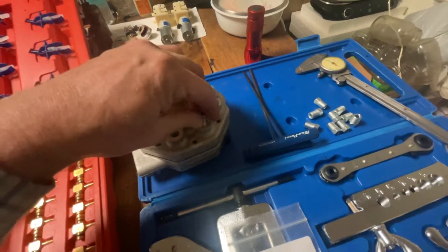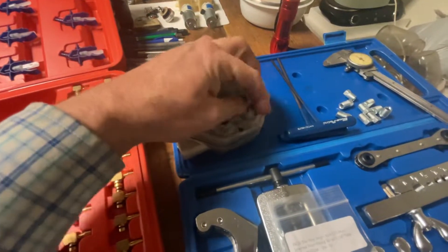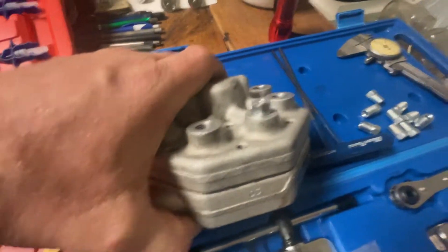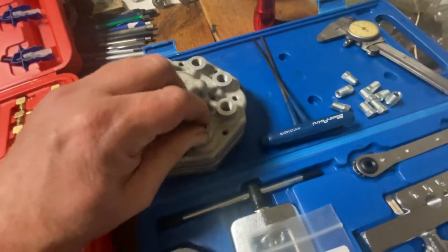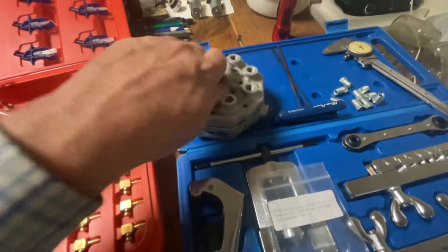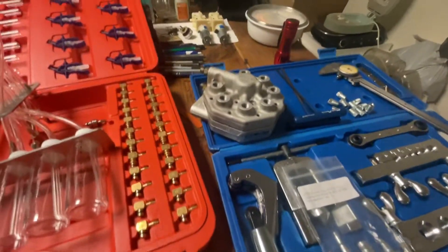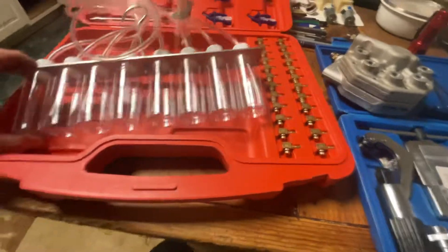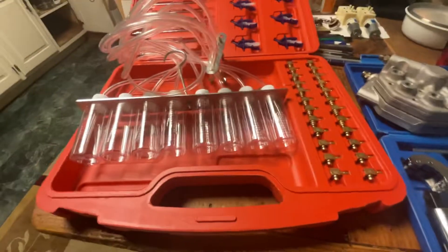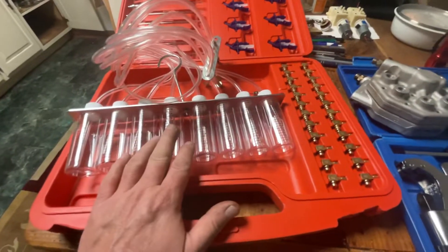The thread has to be long enough for you to bottom out without the flare in it — you can see we still have thread left, so they are long enough to go all the way in. Once you put the pipe on, the line will come out a little further and you'll have enough push against it. Since there's no resistance, not much can overflow, but it will immediately show if anything is wrong.